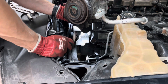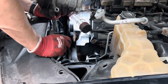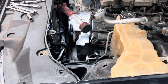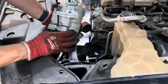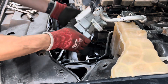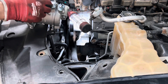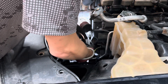Hear just how awful that sounds — that's what I've been listening to every time the engine runs. There's no way that new compressor is going to be the right one because this whole job has gone far too well so far. One really nice thing about this AC compressor is it says right on it that it comes pre-filled with the correct oil, so you don't have to add oil — you just swap it out, charge the system, and go.